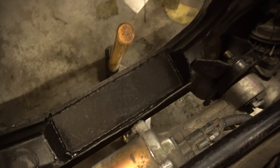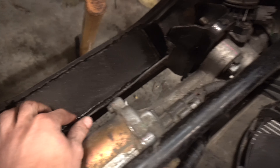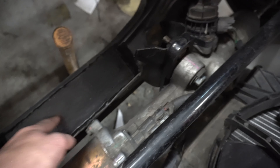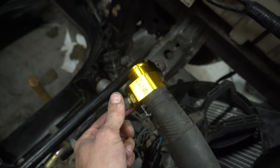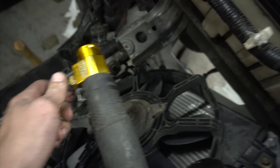Cory's front subframe modification is all done. We basically went flat here and then at a little upward angle for triangulation, giving more clearance up front — eighth-inch plate welded on each side and spray painted black. I went and tapped this ISR coolant fitting M12 by 1.5, which is the thread of the RX8 coolant temperature sensor. Now I'm doing some work on the firewall patch.